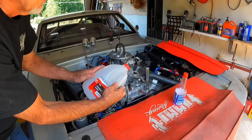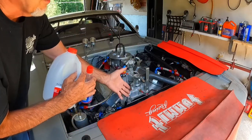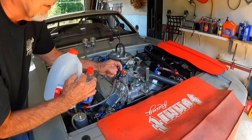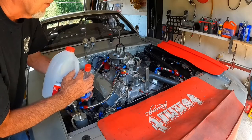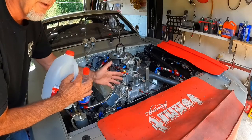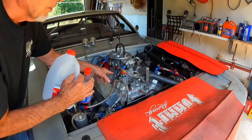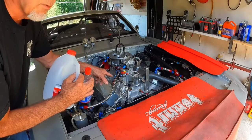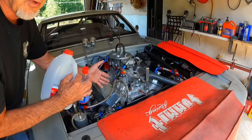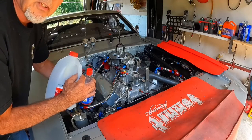Distilled water in conjunction with Water Wetter — and then there are some other things too: gallons per hour on your water pump, running a thermostat or not, or a restriction disc — all of those things can matter, as well as the size of the radiator. It just takes the right combination and you'll have an engine that runs very cool. This happens to be a 908 horsepower engine and I've got to make sure it runs around 180 degrees. I'm happy there even during a hot weather day when I'm traveling to a car show. Thanks for watching everyone — keep working on them, because they're never done.